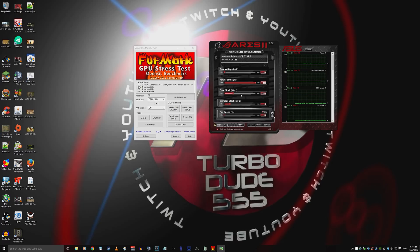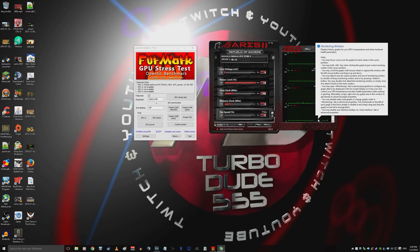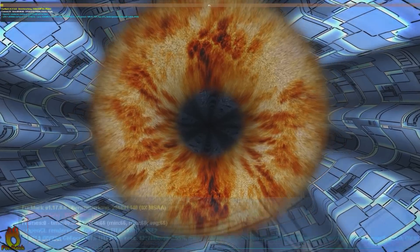There was a driver update for Nvidia today, so while I've done a modest core clock overclock of 200MHz, I can't increase the memory overclock — which is strange. Before I updated the drivers I had a 300MHz overclock on the memory. At least I've got the core clock going, which is great, so I've already got some extra juice out of my GTX Titan X. Wonderful temperatures — idle at about 30 degrees and not even hitting 50 under full load with an overclock.